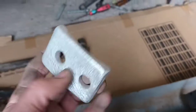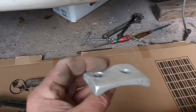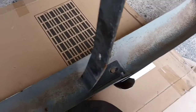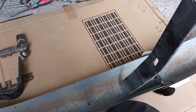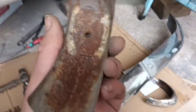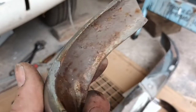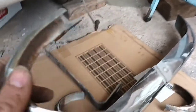I made these for a different car, cast them in aluminium. You can cast aluminium with a propane torch and some sand. And that was actually a bumper spacer. Now I could make something to go in there. Or I could try and bend the end a bit. Now this one's different again. That's only an M8 in there. And that looks like it's been brazed, I would say. And I don't think M8's big enough, really. But that spreads even more.